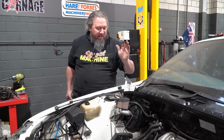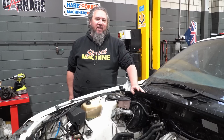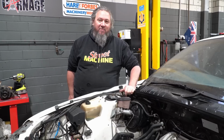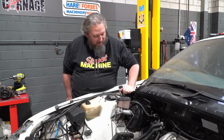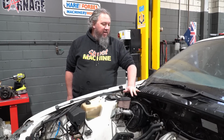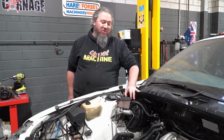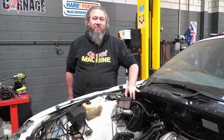But I also have to take our brake booster out. I know a few of you have been saying, just use a VS plastic booster, they're skinny. I guess we're gonna have to do that because we need to get a coil in that last cylinder. So I'm gonna have to remove this whole booster and master cylinder unit, go down the wreckers and get a VS unit and see how that goes. Maybe we didn't need to change the cam cover at all, who knows. But whatever we have to do, we'll do it.